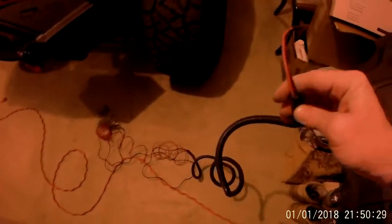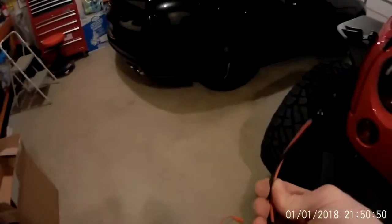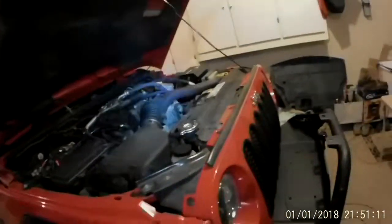I've got my positive and negative wires — 14 gauge — run through some conduit just for protection. I'm going to take this and run it across the back firewall, zip tie it in, and then these two ends we'll splice together through a little hole right there. Then we'll splice in the other light on the other side.